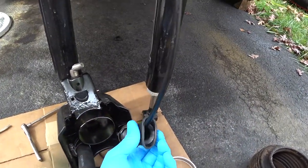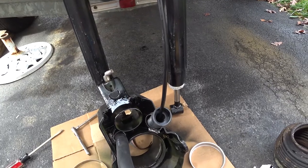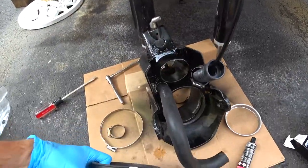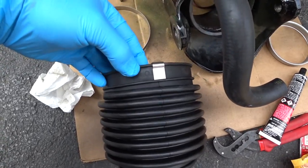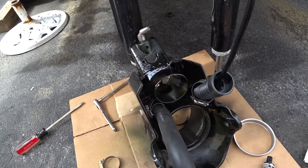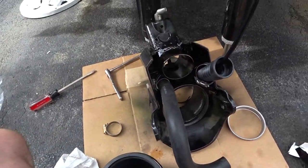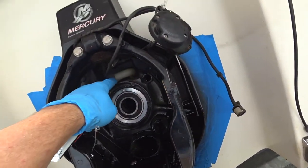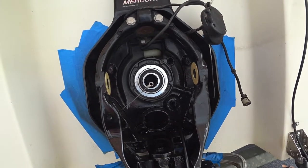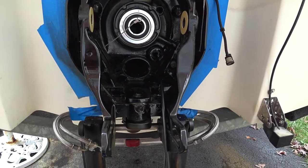New synthane washers are installed. Got the shift cable bellows installed and fed back through the transom, and the water inlet hose attached to the bell housing. Installing the bellows with the gimbal — it's marked 'top' right here, so making sure that's up. The clamp goes on, then bellows adhesive goes on both surfaces per the instructions until tacky — about a 15-minute work time. The bellows should slide right on and I'll tighten the clamp, then put the exhaust bellows on.